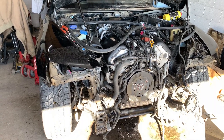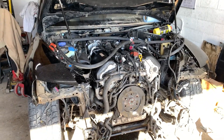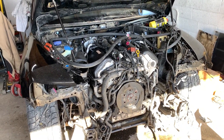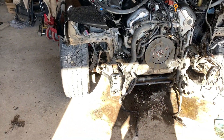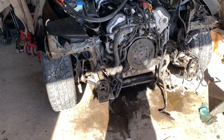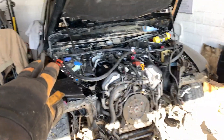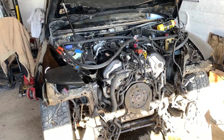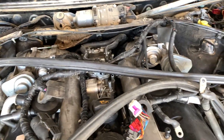It's a new day. I've got the motor bolted in, driveline tightened up, all cross member and subframe bolts torqued down, transfer case and transmission electronics plugged in, transmission shift linkage attached, exhaust attached, front suspension all bolted back together, everything plugged in, and wheels on. We were able to set it down on its wheels. My plan is to work from the back - hooking up the computers and engine harness to the fuse panel, then work forward through the electrical connections, coolant lines, air ducting, wiring harness, cooling lines, fuel connections, and vacuum connections.